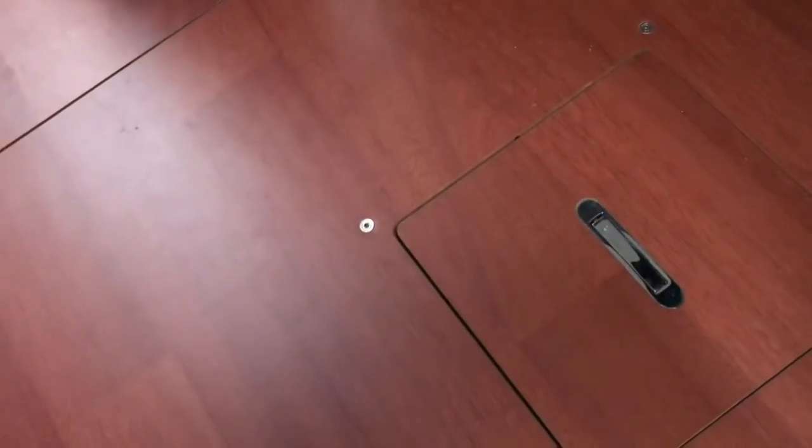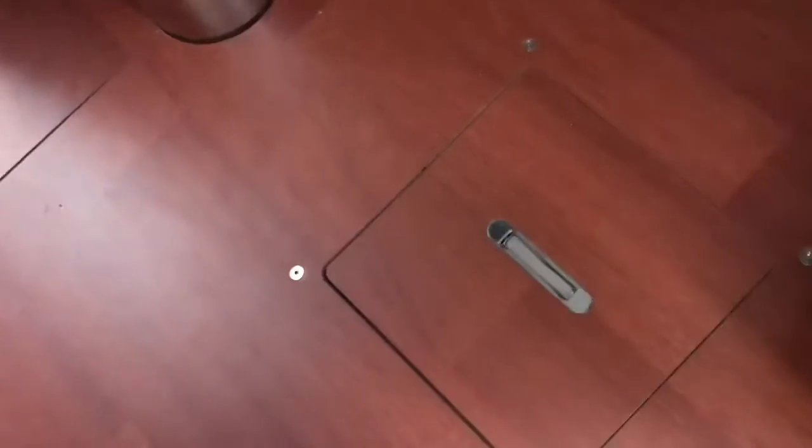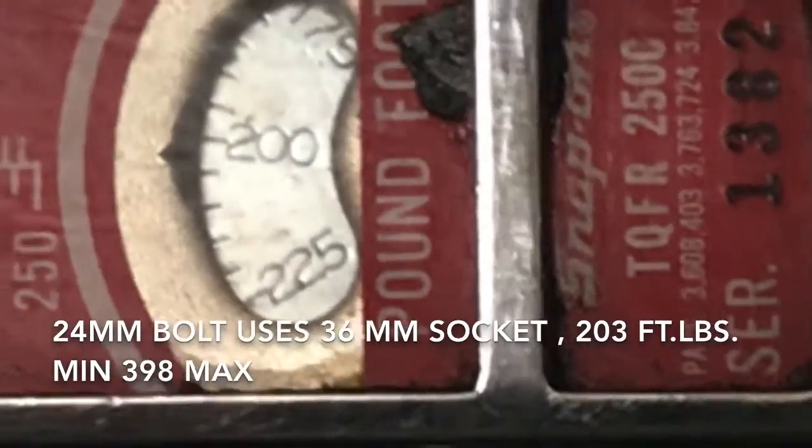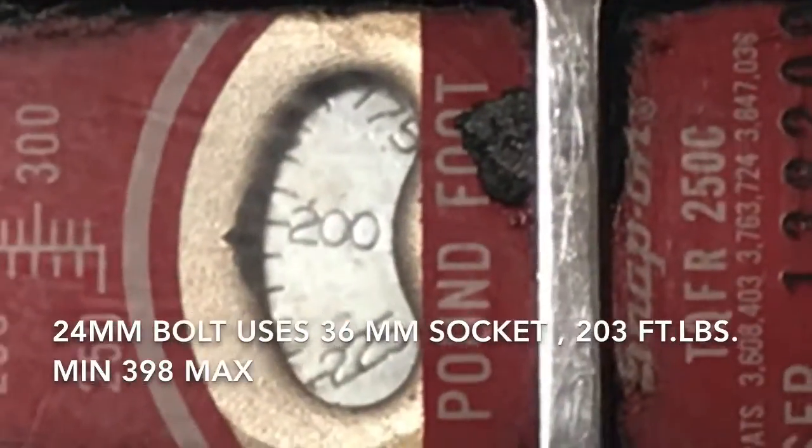There's the holes here. I think they would make this just a tad bit easier. These are gonna come out and the rest of this should be pretty easy to get to. The bolts are right here. We're set at about 205 foot-pounds right here — we'll start there, even though we can go more.